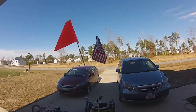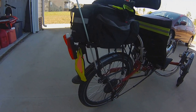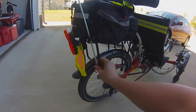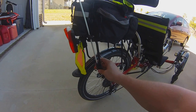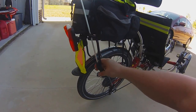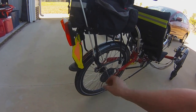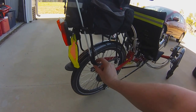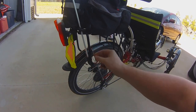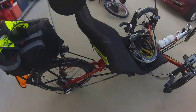And these flags — how I mounted the flags: there was no real good way to mount them directly to the frame with wire ties and they don't interfere with panniers. What I did was get some hose that I bought at a tractor supply outfit and fitted that hose to run for channels. This one takes a little bit of a corner at the end of the stave for the flag. Before I put the flag in there, I tightened this one all the way down, then tightened this one just to get a cinch on the top end. So when I poked the flag in there, it's going down against a taper inside the tube, and the rubber of the tube helps it to grip. I did the same for the forward one.